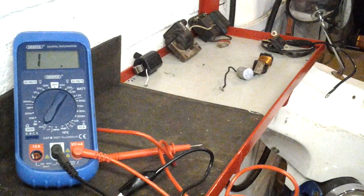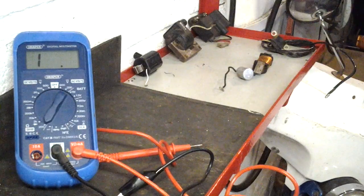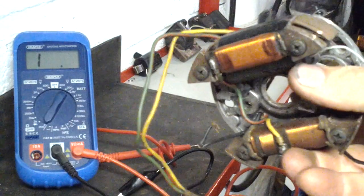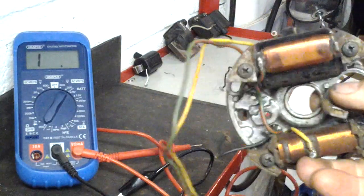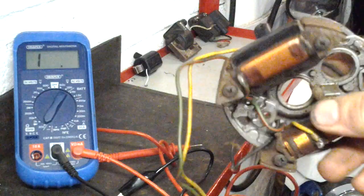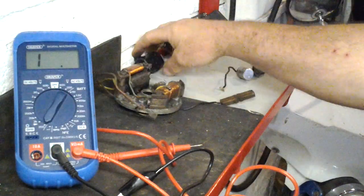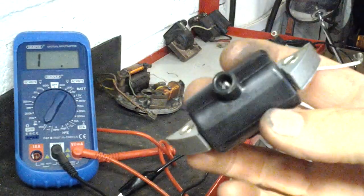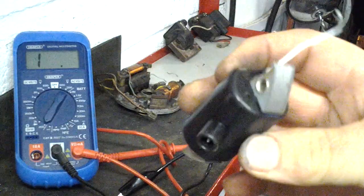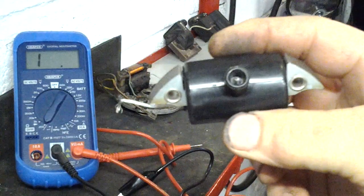On the Maxi and early A3, you'll have a stator plate that looks like this, and the ignition coil is that black thing on it. Ignore the two orange coils — those are for lighting. I have here an aftermarket one for a Maxi or early Tomos A3, and I know for a fact this one has failed, so I'll show you what a failed one looks like first.